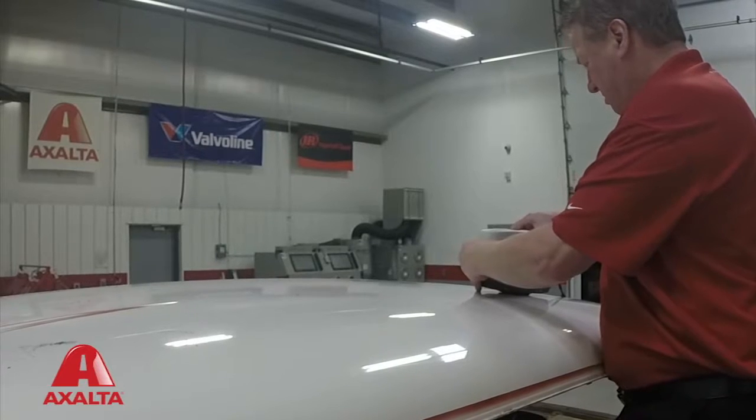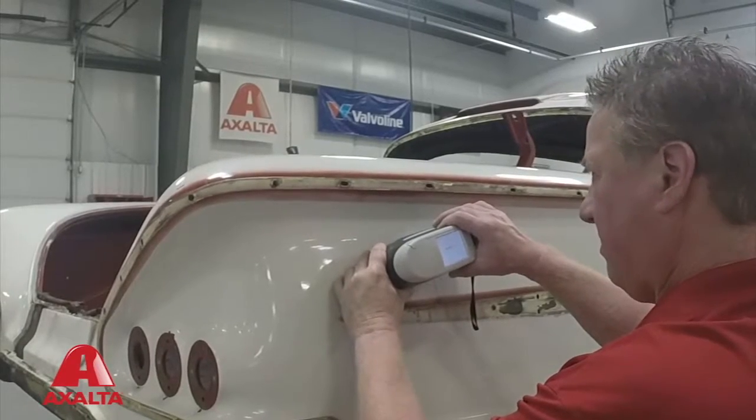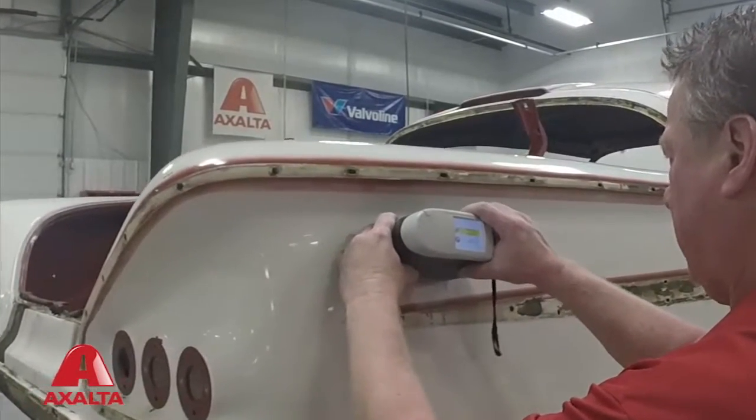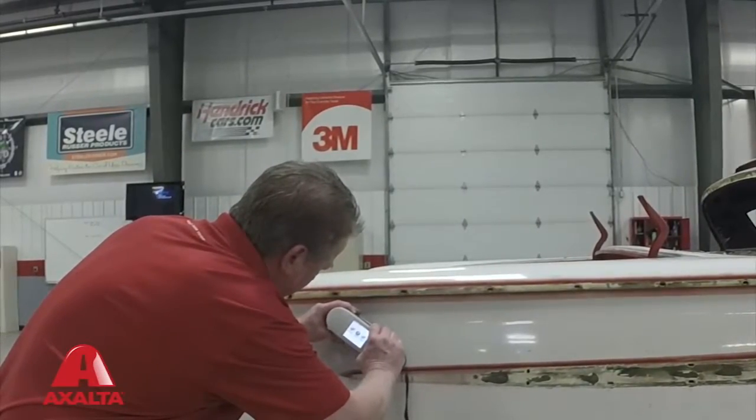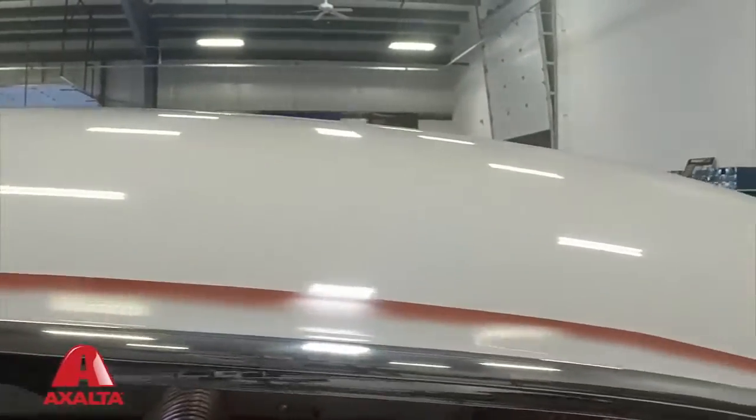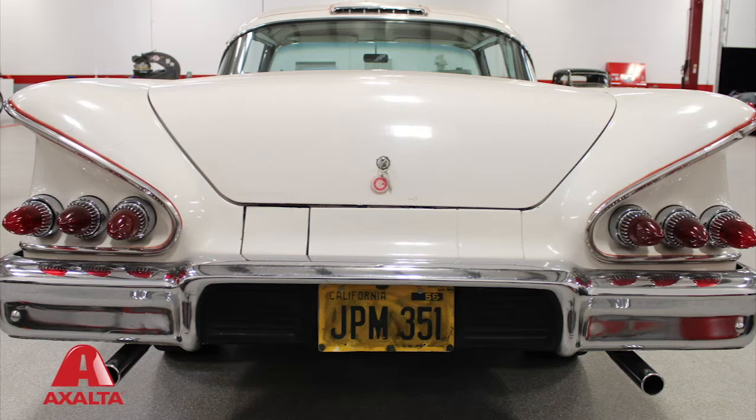And what exactly is the acquire? It's a photo spectrometer and it measures color. But really it is a system designed to imitate real light in a self-contained unit and take multiple shots of the same coating so you get the same color. What are the first things I should do as we move forward? Well, the first thing is document the car — document the condition, the placement of the stripes, all those details. You're going to take an assessment of corrosion, look for rust. And then you're going to disassemble it. Once you get the car apart, it's time to strip paint. We want to take it apart because we're planning on putting new suspension components like ball joints and tie rods — the things that are worn out. It's our goal to make this car drive and look as it did in the movie.